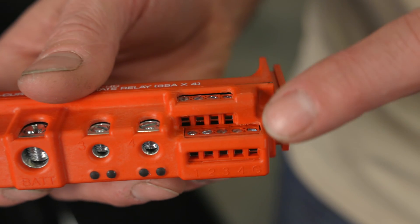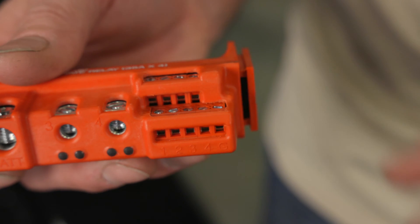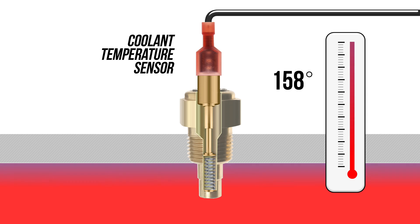One of the coolest things about the MSD solid state relay is its ability to use either a 12 volt positive or a ground trigger to activate it. My trigger for the time delay relay is going to be the grounding action that's provided by the coolant sensor that we installed earlier. To accomplish all this, I'll need to connect the time delay relay as follows.